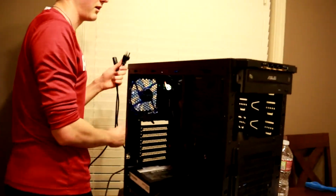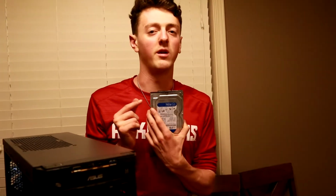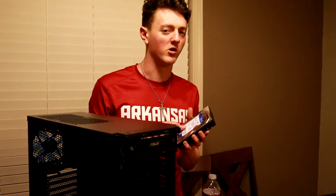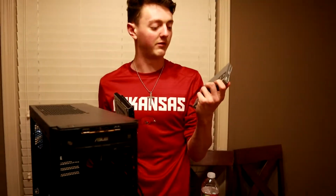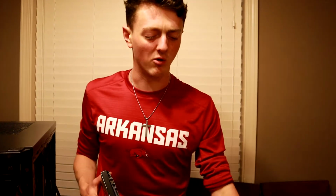So we have hard drives and stuff. We really don't have that much SSD left. His old computer, he bought it pre-built, and it's not a good computer, and so it only came with a hard drive, and they installed Windows on a hard drive, which is not really good for booting up. It makes boot up times really slow, just because of the speed of hard drives. So we always go for the SSDs. They transfer information a lot faster than hard drives. So you always want to get an SSD or something fast to at least install Windows on.